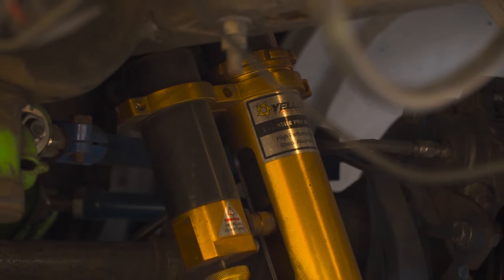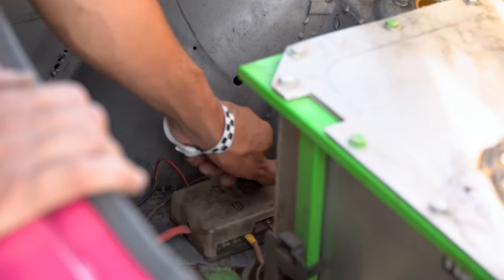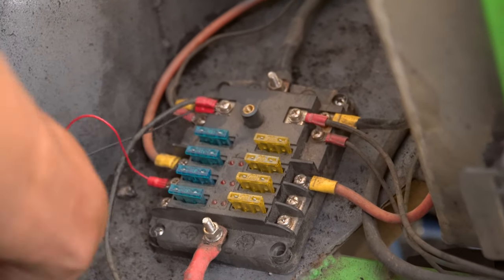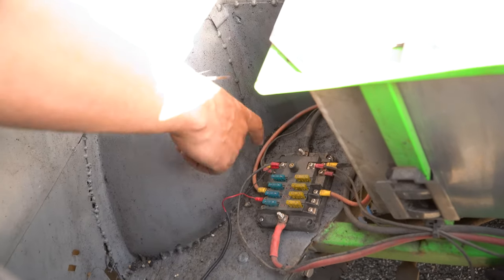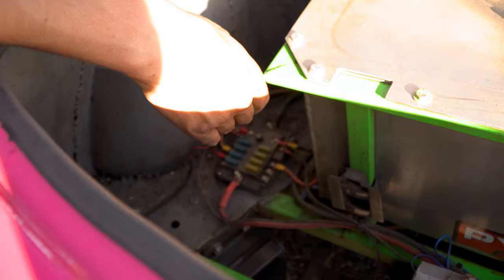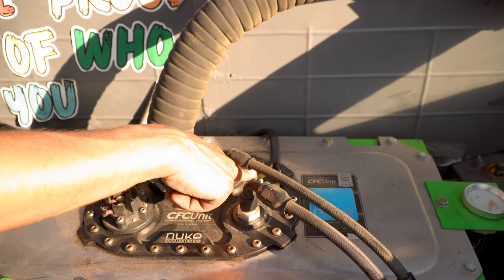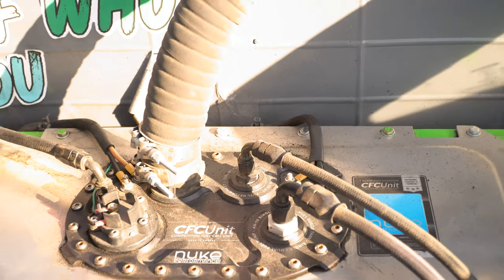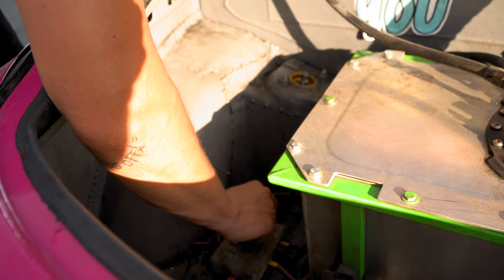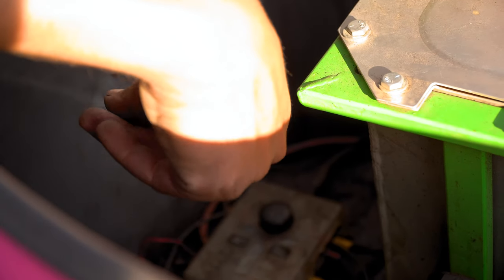In the rear we have the two-way Yellow Speed coilovers. There's a little mini fuel pump panel — power coming in, then fuel pump one and fuel pump two. There's also a backup camera I use for towing. The third backup DW400 fuel pump is ready to go — you'd just take the red wire and move it over to activate it. We have fuses for all the fuel pumps and a little indicator light in the middle that'll tell me if something goes wrong.